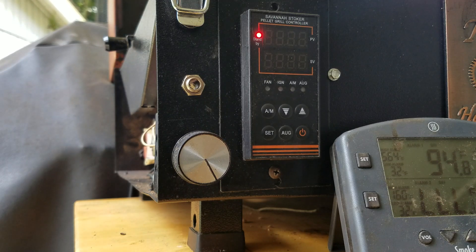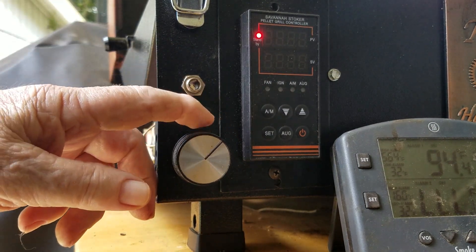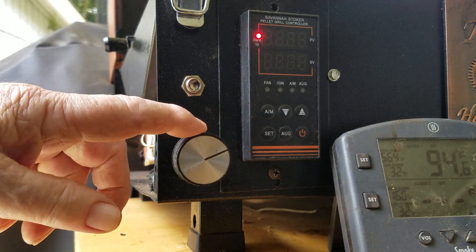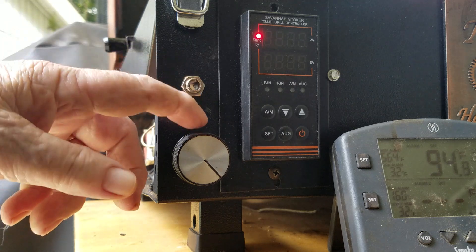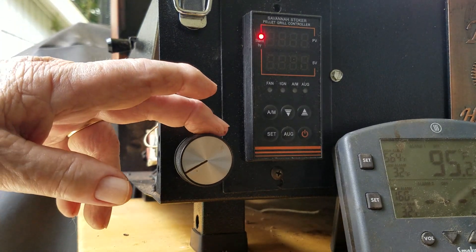This is how I set the rheostat on the Traeger PTG Plus, which is the smallest one with too high of a fan CFM. I installed the rheostat so all the way up is off and all the way down is maximum. I use maximum when I shut down, and sometimes for high temps around 450-500. For roasting around 325-350 I run it mid-range.